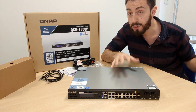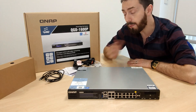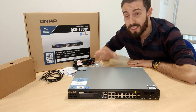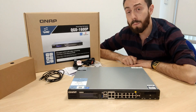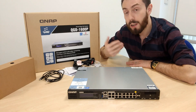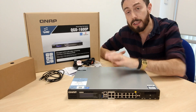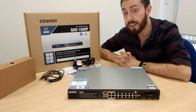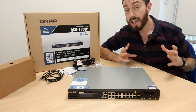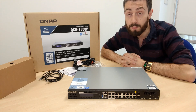You get to choose where your data lives and this device will index from those locations. You've got a multitude of backup strategies, including traditional RAID, with the device arriving with two 2.5-inch bays. Those bays support SSDs — at that size and SATA, commercially available around 4TB each — or 2.5-inch SATA hard drives available at 15mm height at about 5 or 6TB. You can support JBOD, RAID 0, or RAID 1 mirroring. The USB ports also connect hardware RAID expansion units such as the TR002 and TR004, adding two or four more bays of storage per port, so you are not limited by capacity.